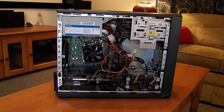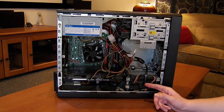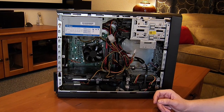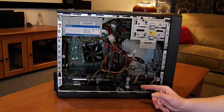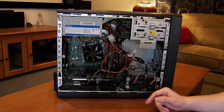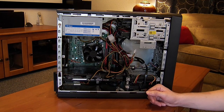As far as our boot drive, we have a bit of an interesting thing here. It is an Apple 256 gig SSD. Where this came from, we found a kind of really destroyed MacBook on the side of the road. The crazy thing is even though it's SATA, they changed the shape of it so you can't plug it into anything normal. At first I thought it was mSATA, but it's something proprietary, or at least the shape anyway. It's still SATA. So I had to get a real funky adapter here to be able to use it like this, but it's been working, and it's been working well.